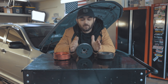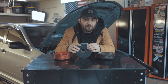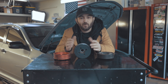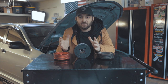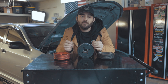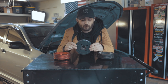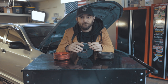With these OEM pulleys when they have rubber packed in them, they are typically tuned from the factory to absorb a very specific frequency of vibration. You have to keep in mind the way an internal combustion engine works — you're generating a ton of little mini explosions inside the engine. From those explosions you're going to have resonation and vibration transmitted down to the crankshaft, and at certain frequencies that can begin to damage things like your engine bearings. If you don't have a way to absorb those vibrations, it can cause excessive wear on materials way faster than they should.